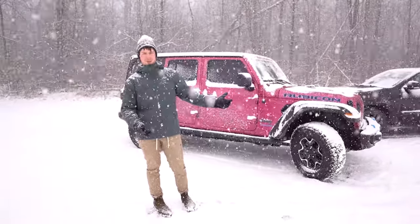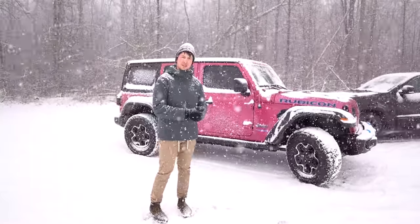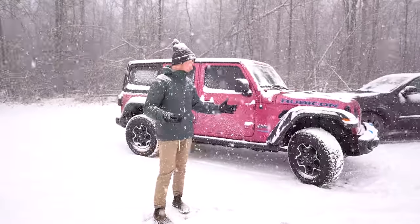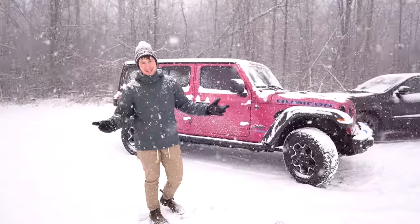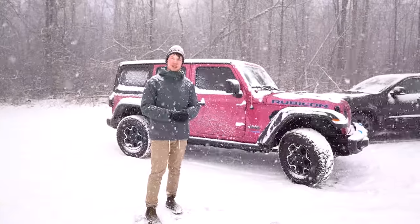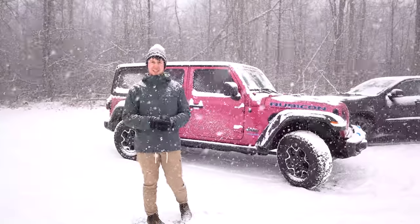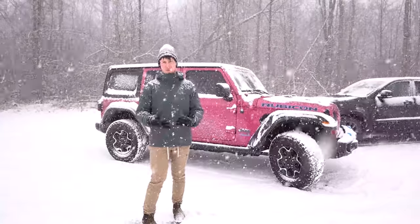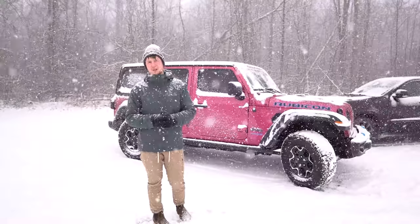I'll put a video up here on the front axle disconnect explaining that. When you put it in full-time four-wheel drive, that front axle disconnect is going to lock, which means your front drive shaft will actually start turning even if you're not using the four-wheel drive. So in two-wheel drive, you'll probably get a little extra fuel economy — maybe half a mile per gallon to one mile per gallon — and save a little wear and tear on the front. Unless you're in a situation where you need full-time four-wheel drive like today, I'd probably leave it in two-wheel drive, but don't feel guilty about using it.